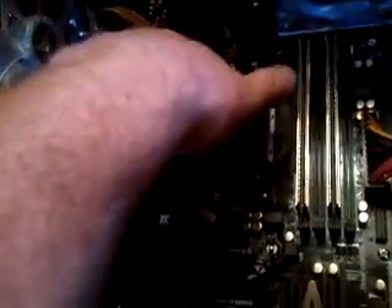Now since we are using the stock fan, go ahead and get that out. First thing you want to look at — you want to make sure this little lever here is open. You want to take this slot and just gently get it on top of your CPU and hook that one side into place.